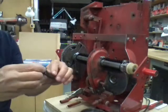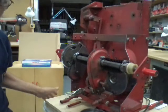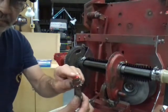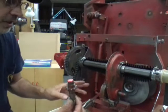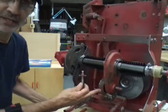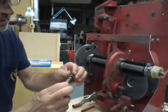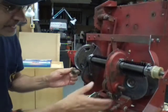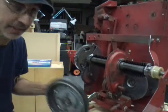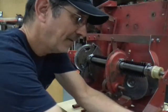This is what it looks like. His is different than mine - mine has the brake on the back side, his has no way of bolting it on; his strictly uses a shoe brake that I don't like. Mine has a band brake - these are a hundred times better. But hopefully this shaft is okay. As bad as it was wobbling around, I have a feeling you're going to have to buy both the clutch disc assembly and that shaft.